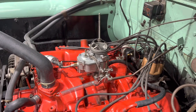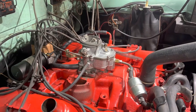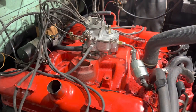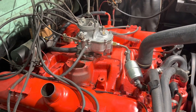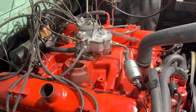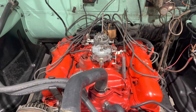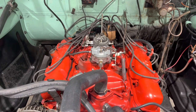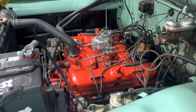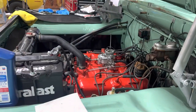Runs good. And that's how you rebuild a Carter BBD. My eyeball on the idle speed was totally wrong, so I did have to turn that down. Now I'll repeat the procedure where I turn the idle screws in by half turns until it starts to stumble, bring them back to where it's smooth — making sure they match side to side — and then back them out another half turn. Call it good. Thanks for watching. And remember, there's no crying in baseball. Now I just have to do a full tune-up. Good thing I got it hot first. But first, pizza.